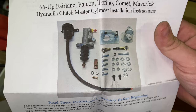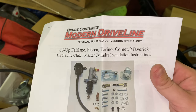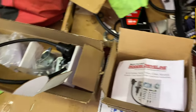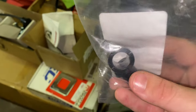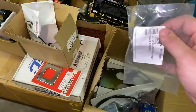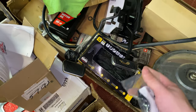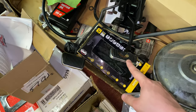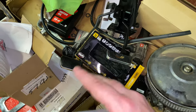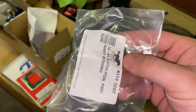I'm going to be going to a hydraulic clutch. So it's going to look like this — this is the master cylinder, reservoir, and all that in the conversion kit. I got it from Modern Driveline. And in here, this is the slave cylinder for the transmission. Now, this kit I got — I couldn't find the pads or the trim ring for a '68 Fairlane or Torino, so what I ended up doing was going to CJ Pony Parts and ordering the pads and trim ring for a '68 Mustang. The exact same thing — it obviously works on here. Same thing for the bushings. Ford used the same size bushings for all their cars like this back in the '60s, so this is actually for a Mustang as well.